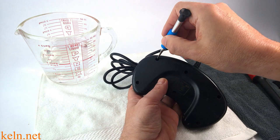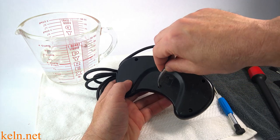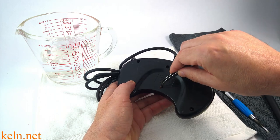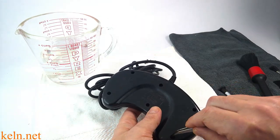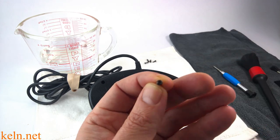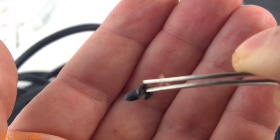Since there's no way to get a video of the screwdriver setting, we're just going to jump in. You'll notice some of them have set in there, and that's just because of how dirty they are — nothing to really worry about. You might also need a small tweezers. Sometimes they'll fall out, sometimes they won't. With a small tweezer, you want to put the tweezer into the slot where the screwdriver head would go, and then one side on the outside, so it's kind of just gripping as you pull out.